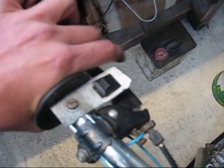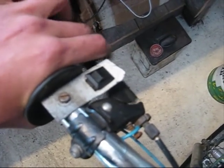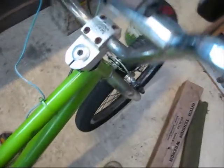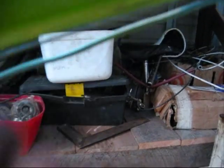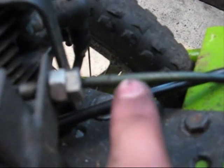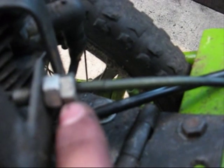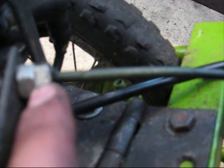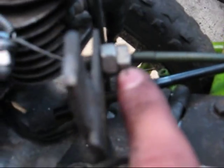I just used a normal bike brake lever for the accelerator, so it just goes down around through what the normal bike would have underneath, under here. And then it goes up to here, and I made this little bracket here. You can see that's the accelerator lever there. That's just an 8mm bolt, which can be used to tension it or adjust it.